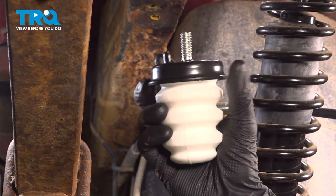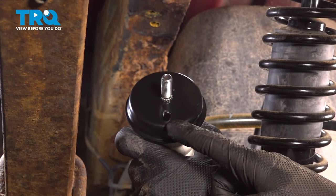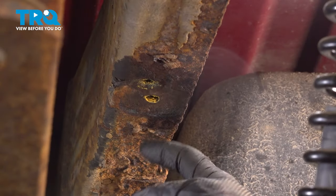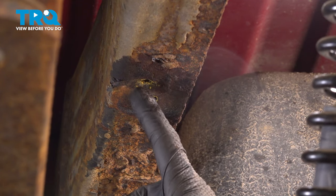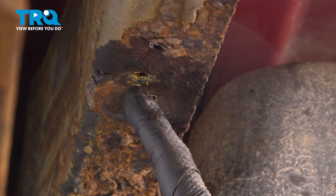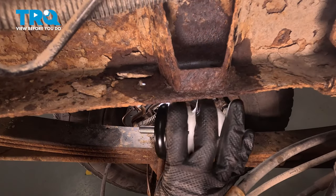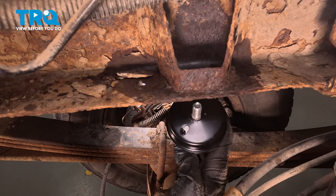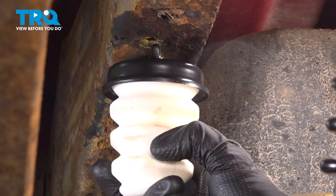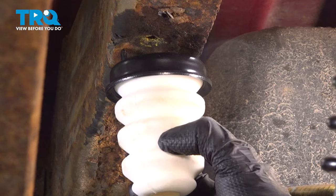Let's get ready for installation of our brand new bumper. Looking at this, you can see that you have the mounting stud, and then you'll also have a small locating tab. If you were to look at the frame — I have it marked in yellow — we have the area for that mounting stud that goes up through our port, and then just to the rear of that, you have another port for that small tab. Let's get this aligned properly. You can see my tab there. If you're misaligned, sitting like this, you can tell it's not going to be seated properly and you're going to have an issue.